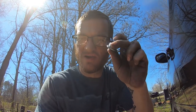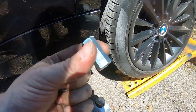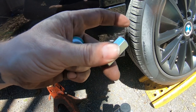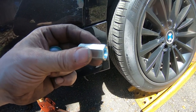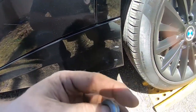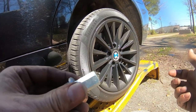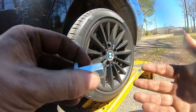When you're trying to get to the fill plug and drain plug on these transfer cases, the space is very limited. What I learned on one of the forums is to use one of these — a coupling nut, sometimes called a long nut. This one is 7/16ths hex size. It actually fits up in there perfectly, and then you can use a 14-millimeter wrench to break it loose. This coupling nut trick lets you reach up into that tight space.